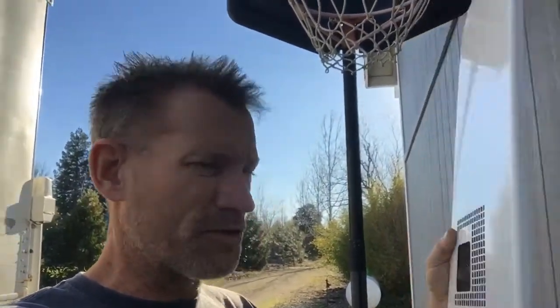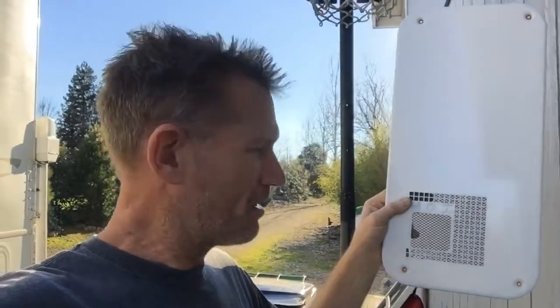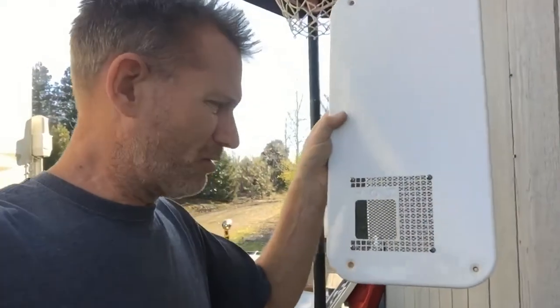Just fan air coming out here now, but it's circulating. This is the cover that goes on the outside of the camper, and I've got the screen on the back there. I'm going to mount that with a couple of stainless steel screws. Normally that hole would just be open, but I've had problems with wasps and stuff wanting to build nests up in the exhaust tube, so I'm going to cover that up. I'll just keep an eye on it when I'm running the furnace.